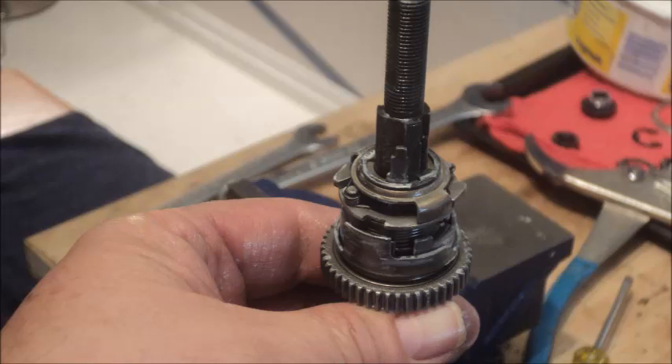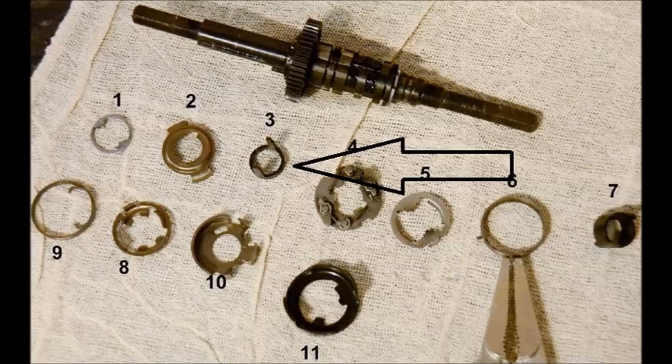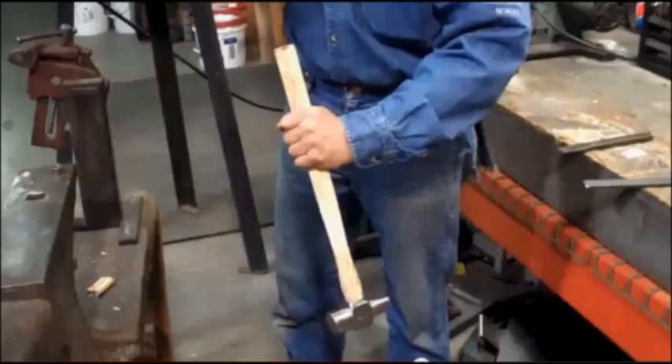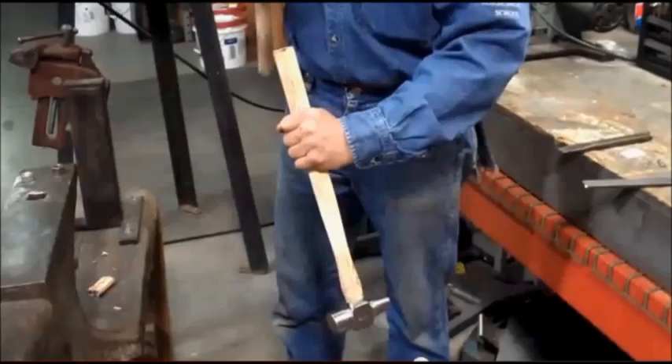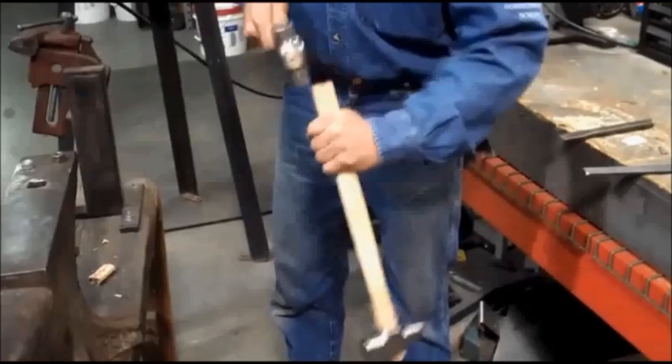Now let's take a look at what could happen should you attempt to remove the cone without this tool. The shift spring sub-assembly is an assemblage of small parts that is not intended to be serviceable. Here's a closer look at the shift key that holds this assemblage together. If you've ever installed a hammer head on a hammer handle, you'll understand the forces involved when you strike on the handle — the hammer head tends to draw up. The same thing happens with the shift spring assembly if the shift key is not held in place while hammering on the axle.